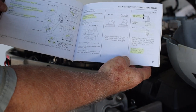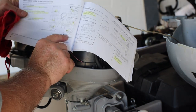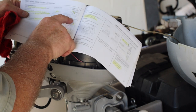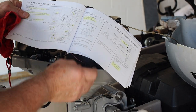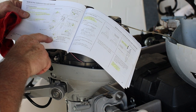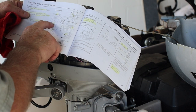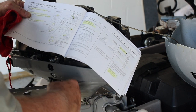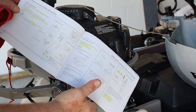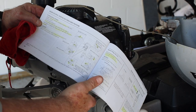One was the swivel of the case — that's that grease fitting we did down here, we did that earlier. Here is the steering handle — I just did that. The throttle arm and choke arm — I'll show you how to do that. The steering friction bolt is over here — I'll show you that. The clamp screws, the tilt lever which is right here, and the throttle arm. It says to lubricate this every 50 hours of operating hours or every six months. I generally do this once a year.